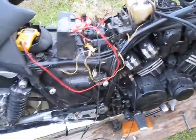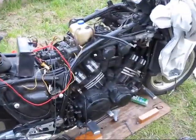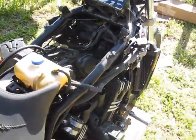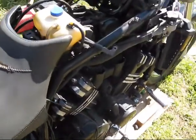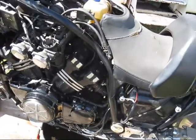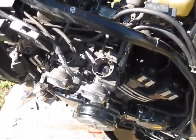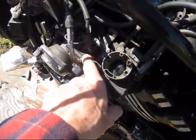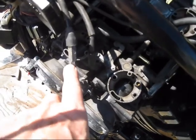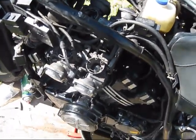We kind of burned out what fuel we had in it anyway. Motor started — now we just press on from here. One more step in the saga: I fired this up, let it run until the thermostat turned on. It was rattling and clanking and popping through the carburetors, but today I got it to where it idles pretty good and I don't hear any bad engine noise. But I'm going to have to clean these carburetors — I've got to take these two throttle cables apart. I think I can just loosen this one up, pull it off to the bottom. These are actually really easy to get loose.